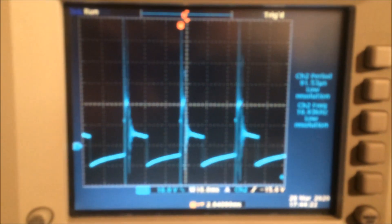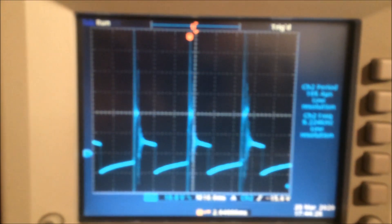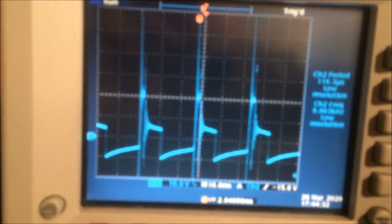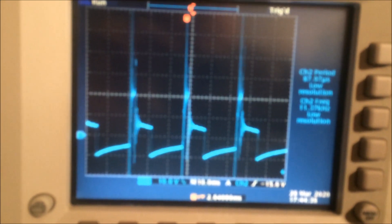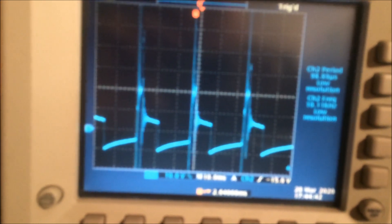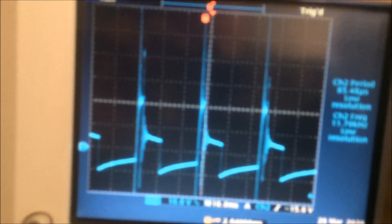The car is actually running a lot better with the stock Delco coil and the ballast resistor removed, so we're just operating at the original 1.4 to 1.5 ohm input resistance of the coil. Now granted, that was at room temperature — when this engine heats up, the copper resistance goes up with the temperature coefficient, about 0.33% per degree Celsius.